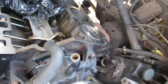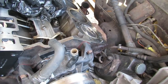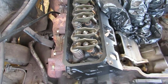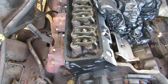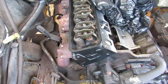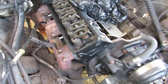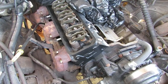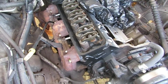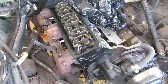The other head was fine; he went ahead and redid it since this one was new. There were two cylinders on that side that leaked. Number six was full of water and number four right beside it had water in it too. The block check fluid I had didn't show a blown head gasket, so it must have been old - there must be a shelf life on it. I threw it away and bought some new stuff at AutoZone.